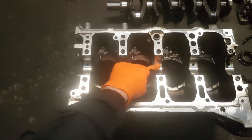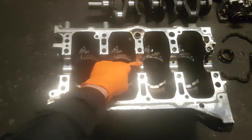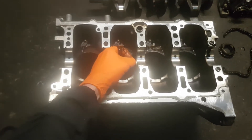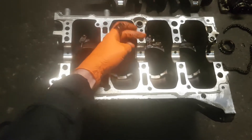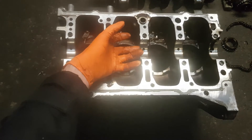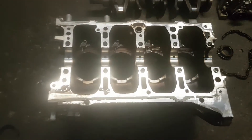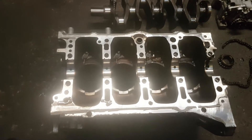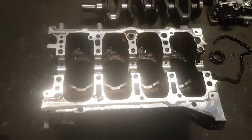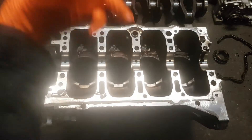When the engine is running and the oil pump is turning, oil will come out of these holes through into the end of the shell bearing. It will be pumped at roughly about 1.5 to 2 bar in a very small, tight gap - under a millimeter. As the crankshaft turns, the oil prevents metal-on-metal contact.